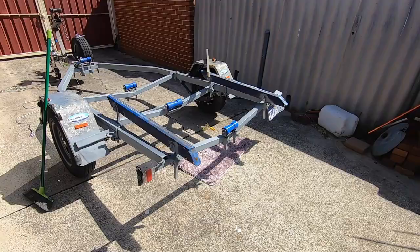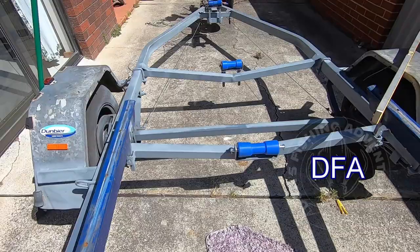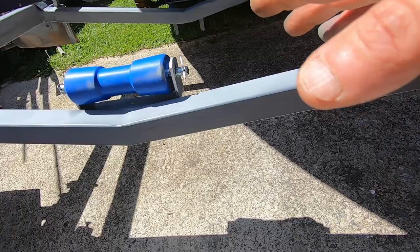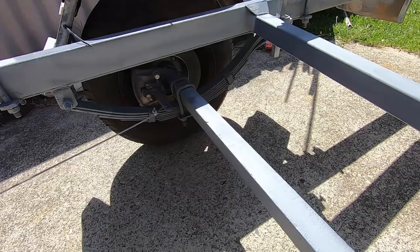Back home with the trailer, been spray painting the panels. Let me show what the work has done: brand new crossbeam, no rust, brand new rollers, touch-up paintwork, brand new hubs and disc brakes. I've reversed the axle so the springs are on top, making it lower, because with a four-wheel drive the high trailer made launching and retrieving awkward — the boat would tip and get wet.